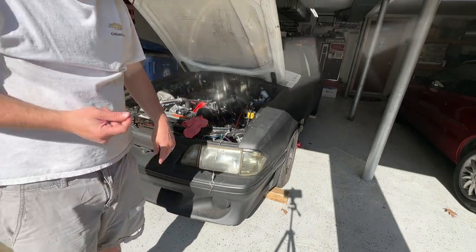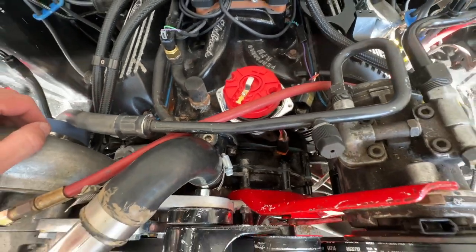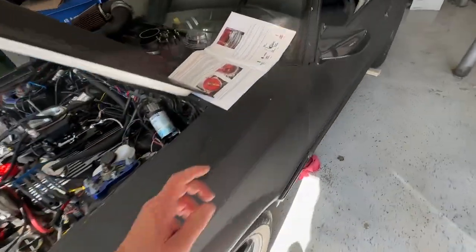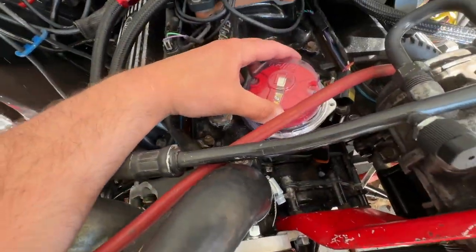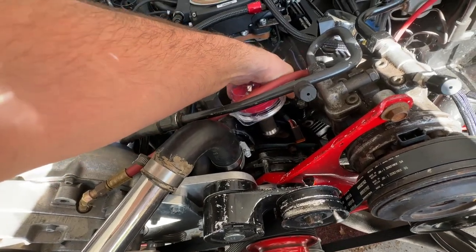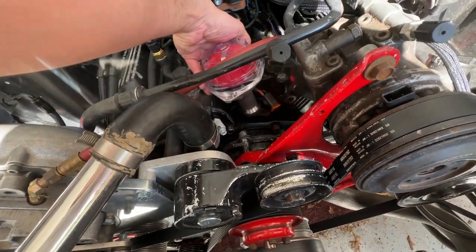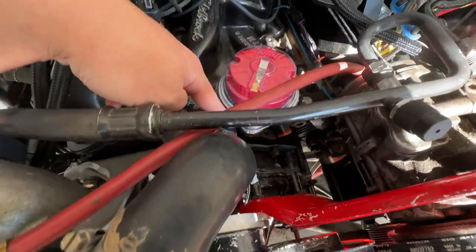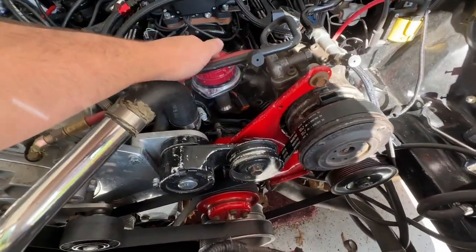After some messing around jumping teeth, we've got it lined up where we want. Using the clear phasing cap, we spin until everything lines up and then rotate the distributor to lock it in. We'll mark the number one position with a sharpie on the cap. Then we'll tighten the distributor down while the clear phasing cap is on so nothing moves — that's where the distributor wrench comes in. I didn't use one for the longest time but once I bought one it made a world of difference.